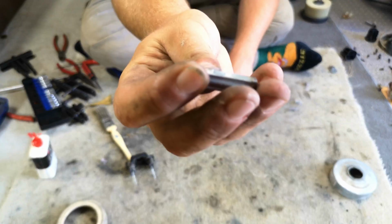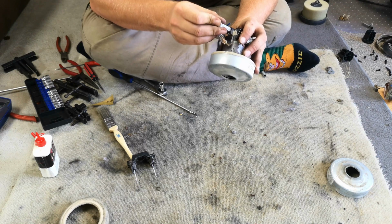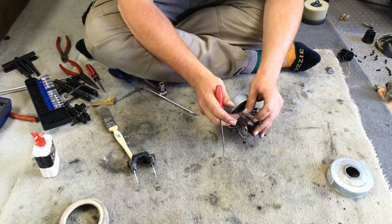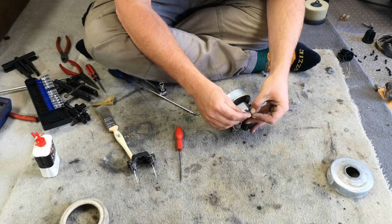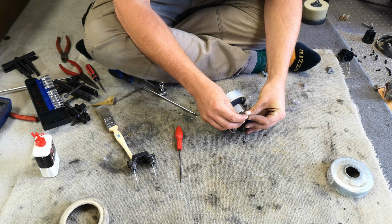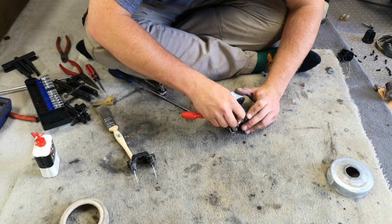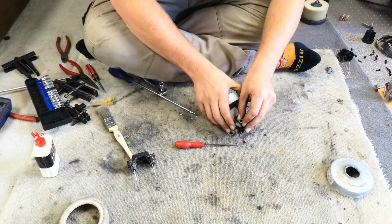The carbon brush holders do have a handy little stop in the back, so you can just push them home and not worry about them fouling the armature like some of the more vintage Hoovers do. They float and you've got to get the distance right in between it and the holder, and then in theory, bah, oof, we can fiddle. Oh, nearly, so close. Yay! And it is a fiddle. Our carbon brush holders back on. Oof. I'll just snap that one. Good job, I've got a spare.